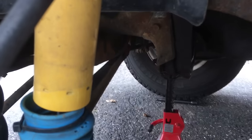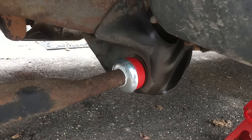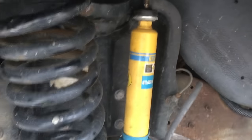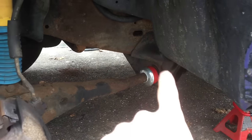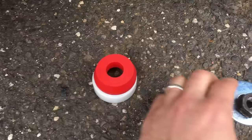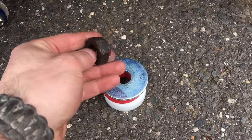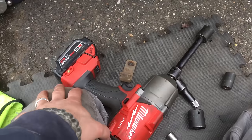You kind of have to do these steps in order — it's a little tricky but you'll get it. Remember: this end in first, then that end. If you do it in reverse you're going to have a hell of a time getting it back together. Once the axle pivot nut is in place and this end was stabbed in first, the next step is to reattach your spring with that mounting piece up top and put your bolt on your shock. The very last step is putting the nut on this. The order is: spacer goes on first, then the bushing, then the washer, then the nut. When I put it all together I was just barely able to get those first few threads, but it was just enough. Get it started slowly, and when you've got it most of the way, send it home with all the torque you have.